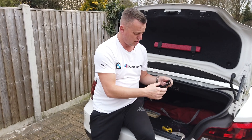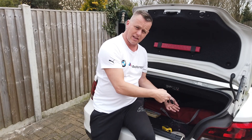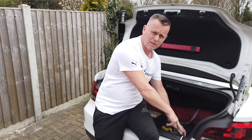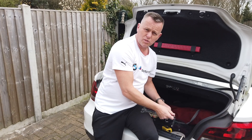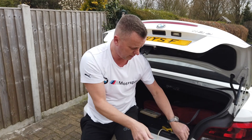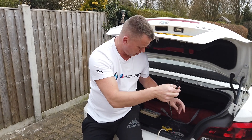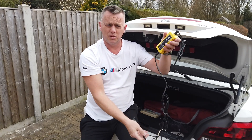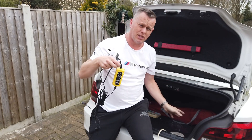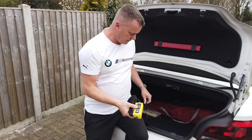You've got a negative and positive through a fusible link. The idea is you can have it at a point poking out the boot. If this car were a classic that I was never going to use, I would bolt these two wires to the battery's negative and positive terminals and leave the connector hanging out somewhere from the boot. When I want to park it and leave it in the garage, I pull this out, shut the boot down on the wire with it hanging out, connect that into the charger, plug it in the wall, and just leave it on all the time.